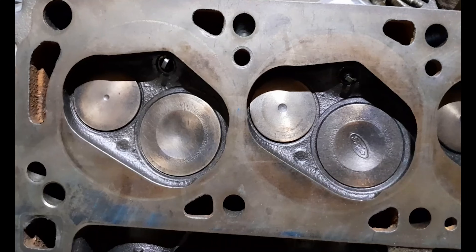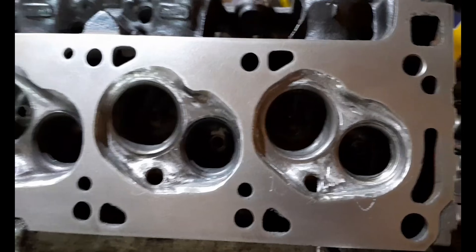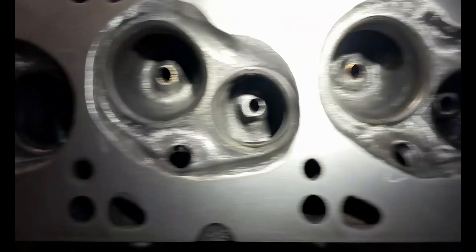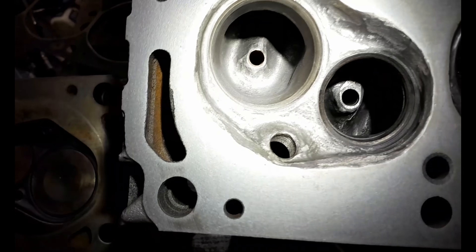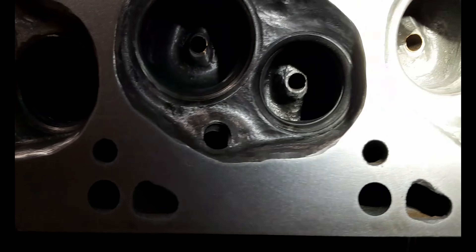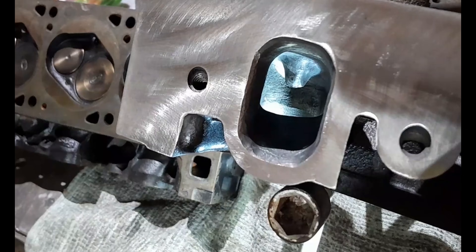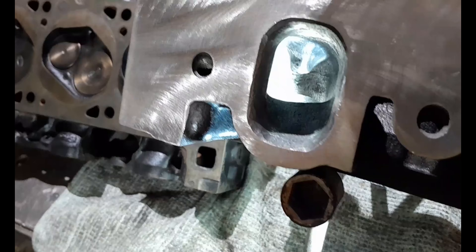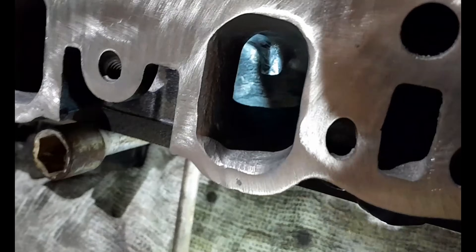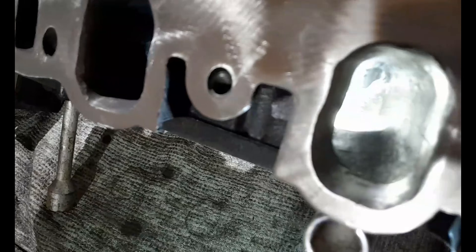As you can see, the valves are pretty shrouded in stock form. This is what I've just done with the other cylinder head — de-shrouding the valves. And of course no decent port job would be complete without a good bowl blend. Exhaust and intake blended beautifully all the way to the valve seats, and you can see the valve stem bosses in each bowl — they've all been thinned down completely for maximum airflow. Every intake runner and valve guide boss completely deburred and smoothed, and the valve guide bosses are completely thinned down on all the intakes.